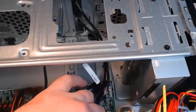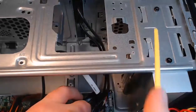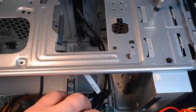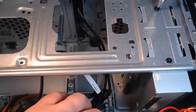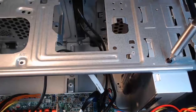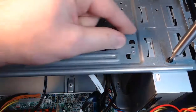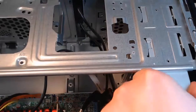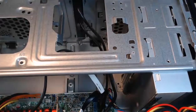We've got a couple of things to get it out. Number one, I've got two screws — one here and one here — that we need to remove. As we're removing these screws, think about this: the power supply is right behind this optical drive. Which way is this optical drive going to go to get out of our case? Is it going back into the power supply, or do we have to pull it out the front? Screws are out. Optical drive is ready — what we need to do is turn the case so the front is facing up and pop off the front plastic of our case.